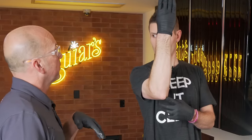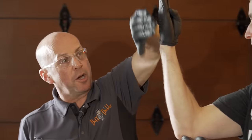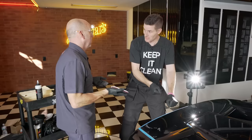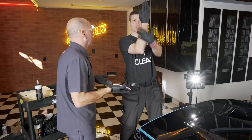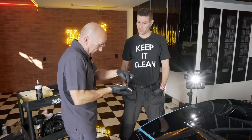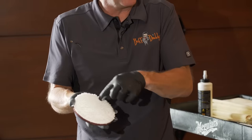If this is a string, you know, if this is a fiber, I want to make sure it's encompassed with buffing liquid, which has abrasive in it. So if it drags across that surface, there's a very good chance it's going to cut away paint. And when you have this quantity of strings, it happens rapid. Right, and most people, you see traditionally, you put one dot, three dots, and then they just put it down. And at that point, if your string isn't coated all in your product, what happens? Well, not only that, but microfiber, since it is so good at grabbing and holding, that dot will not spread such as it might on a slippery or foam pad.